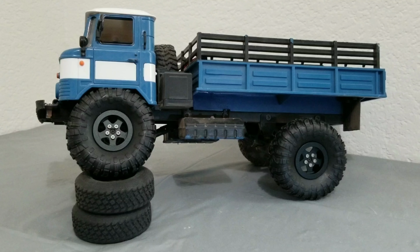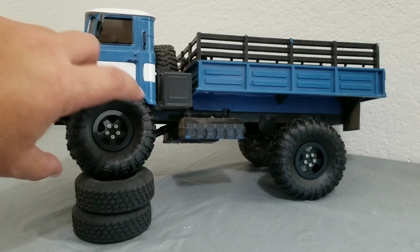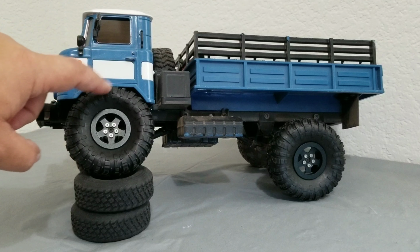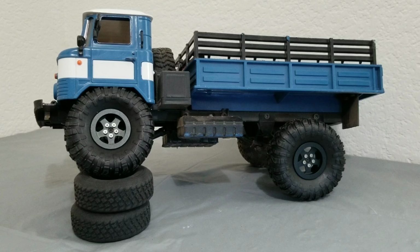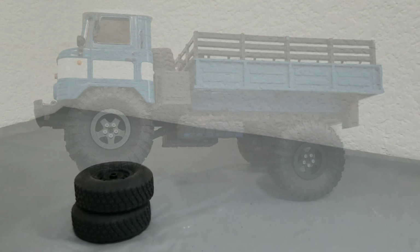Here it is on my B24 kit. As you can tell right here with my flex mod and stuff, the tire is definitely going to rub up here for sure, because that's not even full flex still. It's a lot more to go, but that is going to rub up there. The only way I could see around it, if you really want to use bigger tires like this on this kind of rig, is you're going to have to get that upgraded leaf spring mod for the leaf springs to kind of jack up the truck a little bit. That might eliminate the rubbing issue right here.